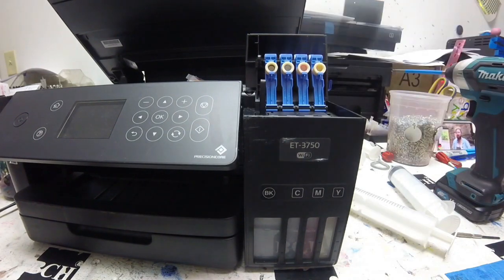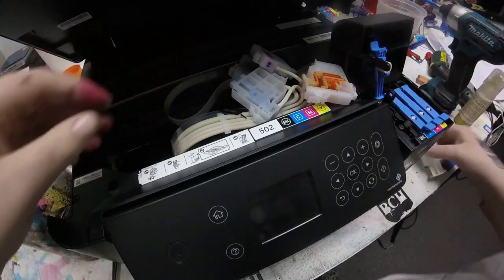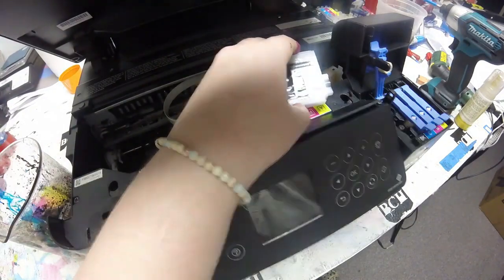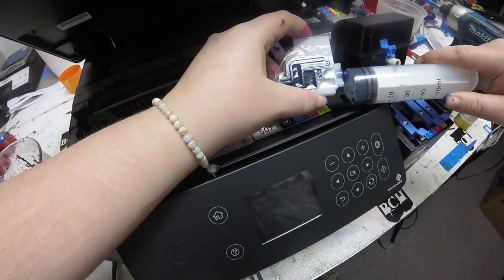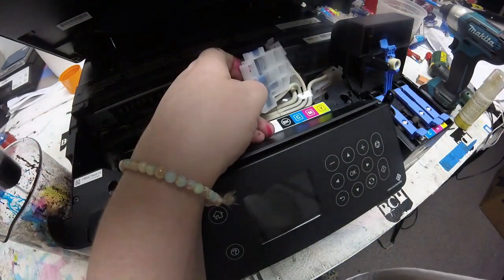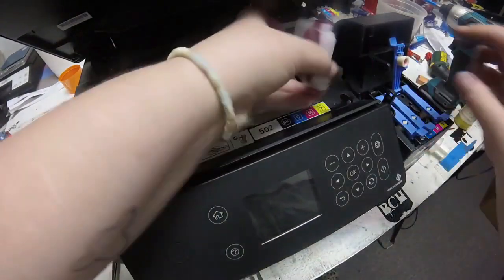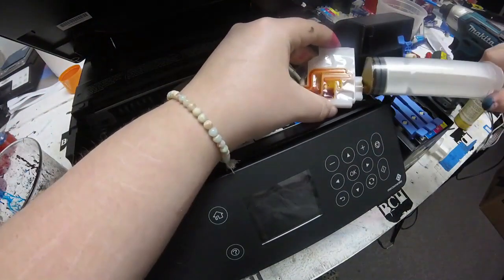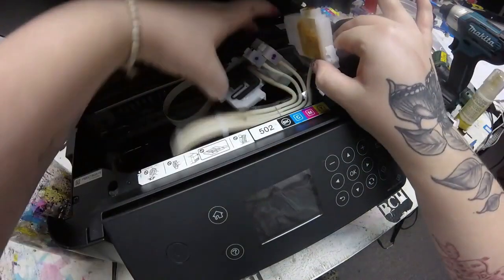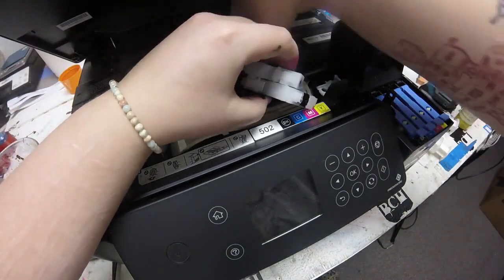If you picked up where we're going with this from the first process — now that I filled that up, I'm going to take my syringe again, pop open that cover on the right side corresponding to the black, and pull some of the sublimation ink through. I don't have to pull it all — I'm just trying to pull enough ink to get into the cartridges. You can see there's still some ink but you can see some sublimation ink in there. I try to shake it up to mix it with the regular ink — you can see the different color in the yellow sublimation ink versus the regular yellow ink, which is why I'm shaking that to get them combined and mixed together for printing.